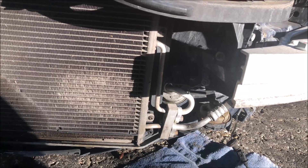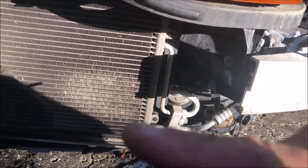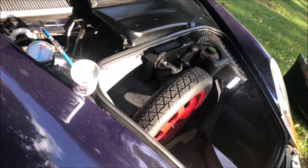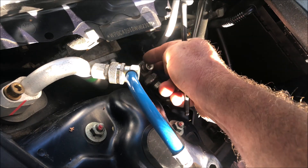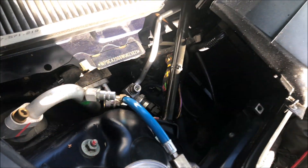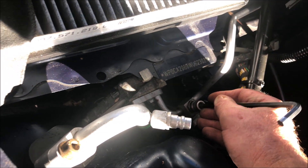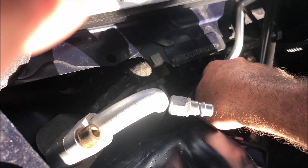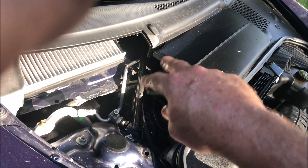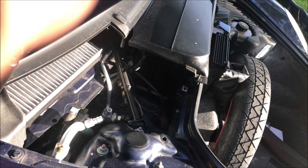I'm going to go full danger mode here—I think there's a little pressure left in the system, I can hear it hissing a little bit. If you want to release the pressure, you can go up to the Schrader valve. High pressure has the black cap on it. It's the big one—the small one is where you fill from. It's like a bicycle valve, a Schrader valve. If you push down on it, that will release the pressure—it's probably going to blast off your hand. Put a rag in there, because the oil and all the refrigerant is going to blast out all over you. That's how you can release the pressure if you have to.